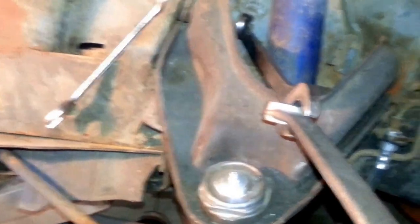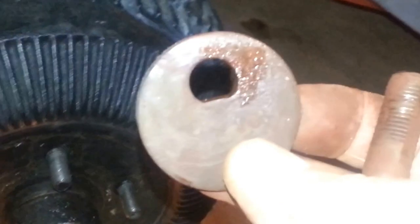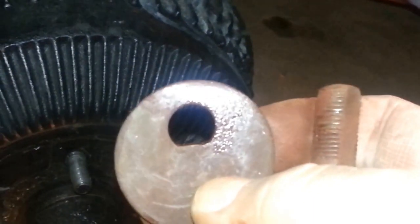This is the back bolt that's out of there. It rides inside like so, and that's how they do the alignment — there's a cam bolt on there. On the opposite end, this bolt has a flattened side on the inside, and that's to adjust camber or caster with the alignment.